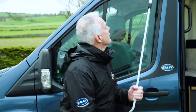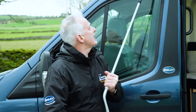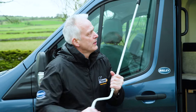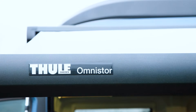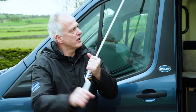Holding both white handles, all you do is simply turn it in a clockwise direction. Keep some upwards pressure so that the pole stays in the awning slot and keep winding until it's fully extended. You'll know because there are aluminium arms in the middle and you'll see when they are about to go taut.